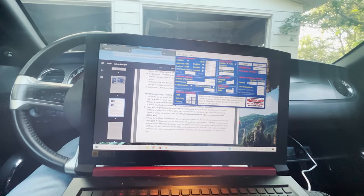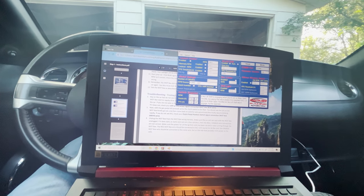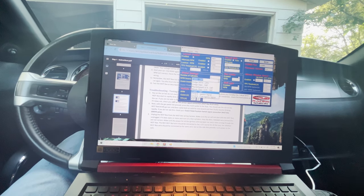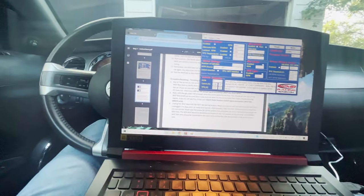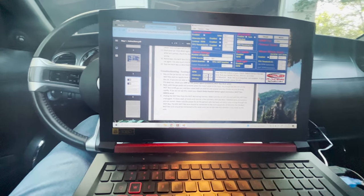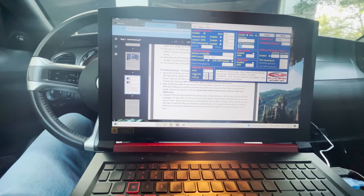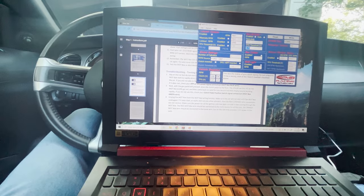So you can change your delay for your no lift shift, and you can set up your launch control two-step over here. When you come in, you do have to change your source to the Ford crankshaft position sensor. It came on Dodge SRT4. So you change that, and then you're looking down here at the vehicle snapshot. The first test is to push the gas all the way in and hit read. So it shows 1.98 and it shows down, which is good. The other one is the clutch. So if I push the clutch down and hit read, it shows the full 5 volts down.